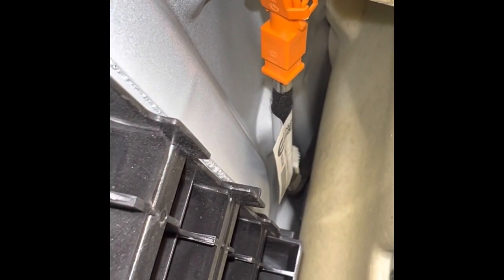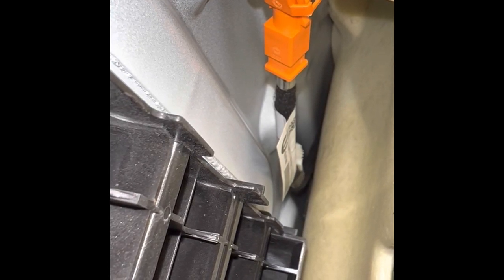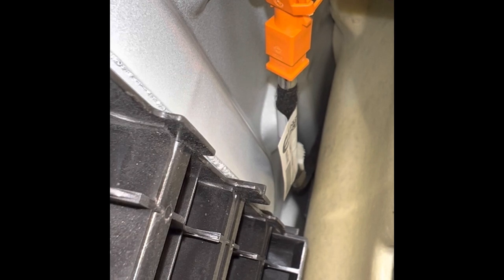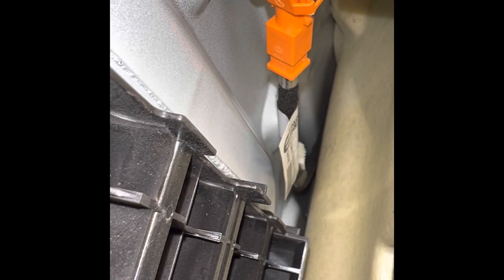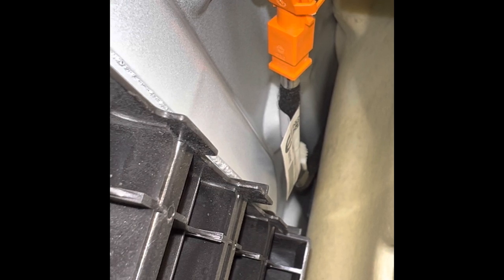It was not intentional for RAM to make the camera not work. I pulled the piece back on the back wall going down to the fender, and that is the connection that is not completely inserted - that's exactly how I found it. So let me get that plugged in, plug the camera back into the bumper, and if you've got the port on the bumper it should work then.